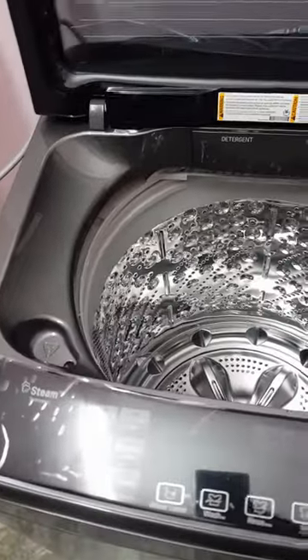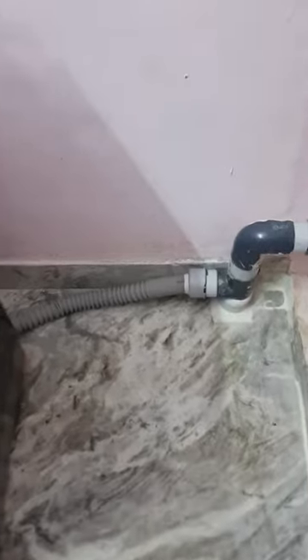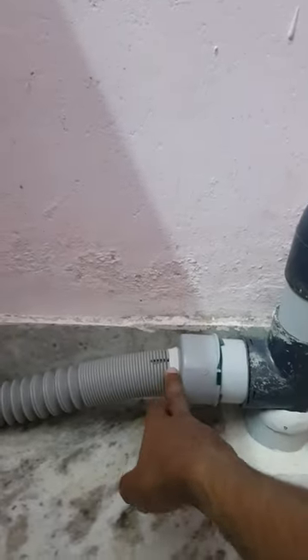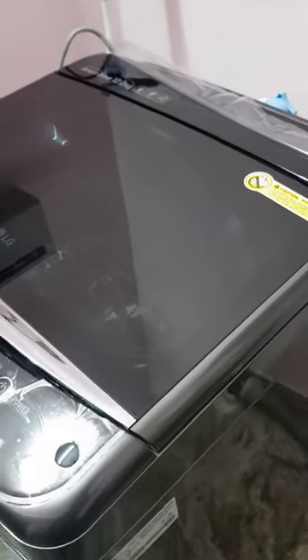The missing drain pump was a headache for me and I had to redo the plumbing for my drainage system. I somehow managed it. The maximum height of the exit drain pipe from the ground should be nine centimeters, and I was able to bring it exactly to nine centimeters, so that issue was fixed.